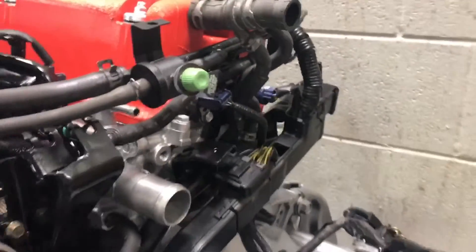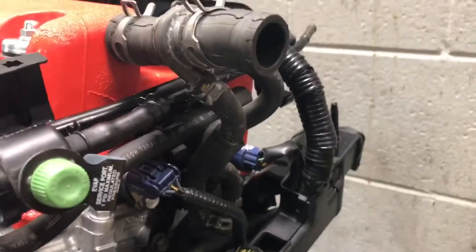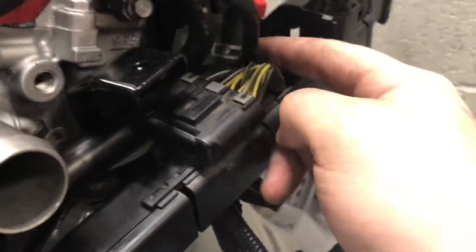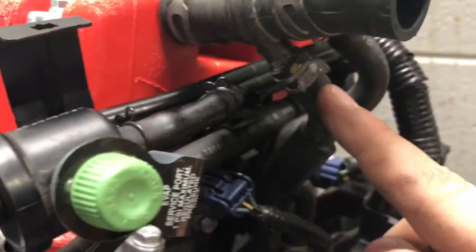This is kind of tricky when you're doing it by yourself, or even with friends, and you have no idea where things go. So this one right here just goes straight to your intake. And then you have this loop right here — it goes down, it goes behind here. The one on the furthest end goes down to the hard pipe, and the one closest sticking out — this hose right here — goes down and goes below.